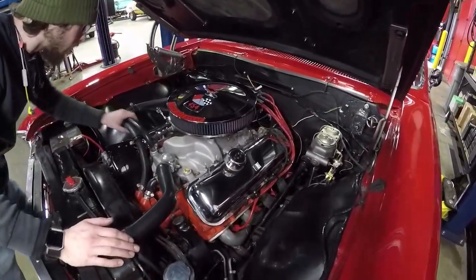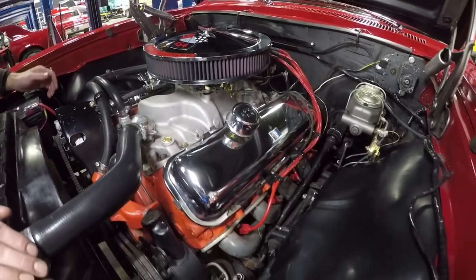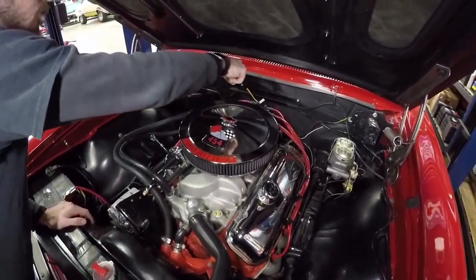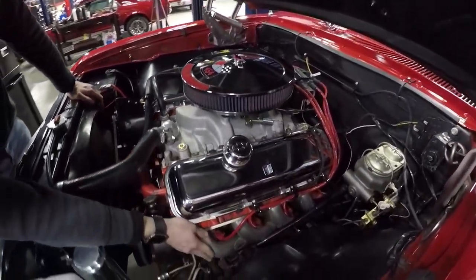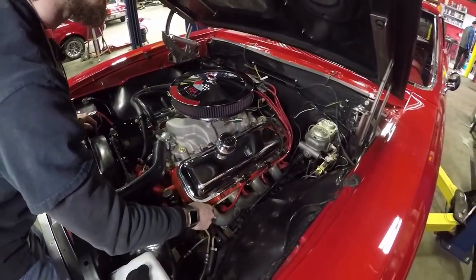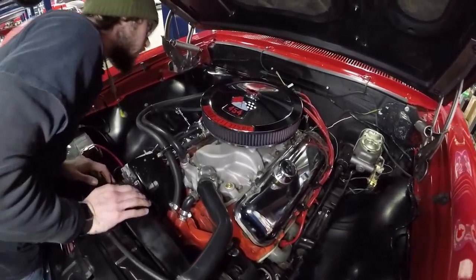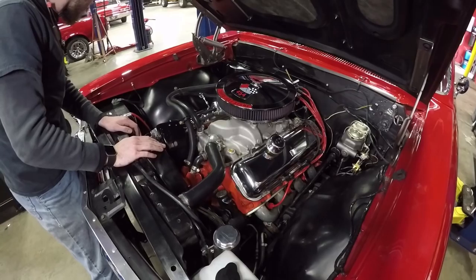All the heater hoses look like they've been replaced at one point. Nice-looking fuel line on it. It does have a set of Taylor spark plug wires on it. We do have power steering on this car as well with the dual belt pulley setup. Looks like the alternator is relatively fresh, pretty nice paint job on the motor, factory-type valve covers on it. We have the HEI distributor here in the back. You can see these big massive primary Hooker headers on this with the jet coat. It looks like the car has had a recent alignment on it as well. It has manual brakes and you can see a relatively fresh master cylinder. Firewall looks like it's in good shape, inner fenders look nice, and there's an upgraded catch can here for radiator overflow. Relatively recent hoses on it, and this thing was even holding fuel pressure for quite some time, which means the seals on the fuel pump are good. We do have a K&N air filter and a modern battery.